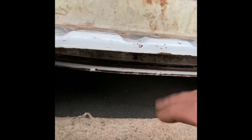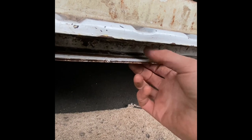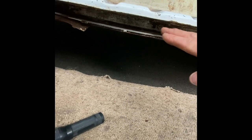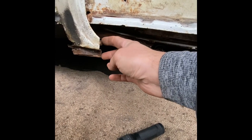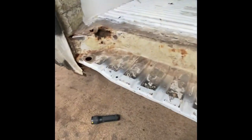The whole hole underneath the runner area is all rotten off. This is what the door sits on. Previously, about four years ago, I repaired this track by making a piece of steel and sitting it on top — you can see where I just spot welded it in. But the actual metal that this is set on is now completely rotten, so it has very little support. It's only a matter of time before the whole door literally falls off, so all of this needs reconstructing, including the bit where the rubber goes on.